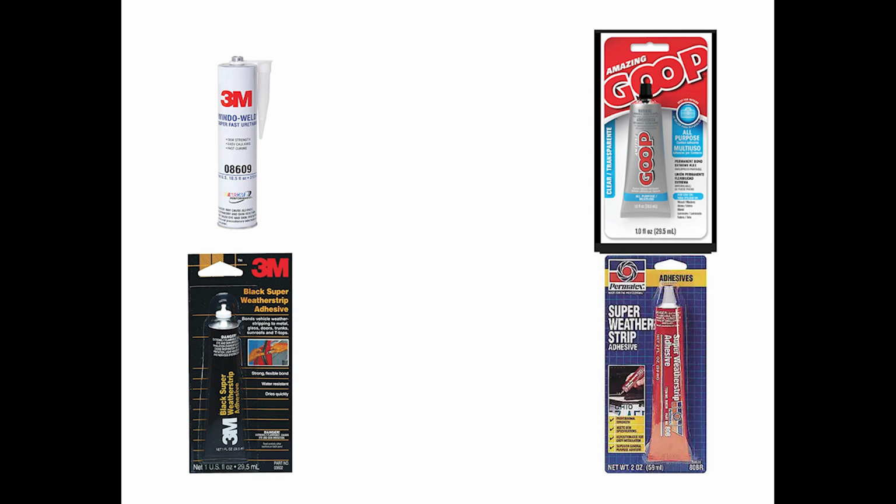Okay, for this project, we're going to use 3M weather strip adhesive, and always use the black because it just looks so much better than that yellow stuff getting slopped all over your molding. And my personal favorite is Amazing Goop. It works good. It dries clear and it dries hard, and it does really well. Or you can use some 3M window weld urethane like you use on late model windshields. A lot of guys like that. Or you can use Permatex weather strip adhesive. Or some people just prefer a regular silicone, and it comes in clear and black.